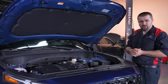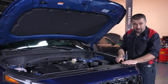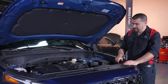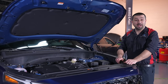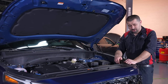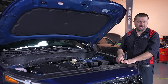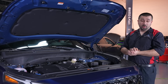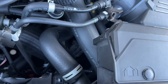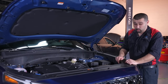Here's an old school-new school mix in a bad way. Older cars used air-to-air intercoolers, but air-to-liquid intercoolers are much more compact and efficient. And vacuum-controlled wastegates work better than electronic wastegates, which suffer from exhaust heat issues. Unfortunately, Hyundai went the wrong way on both counts: they used an air-to-air intercooler, which is inefficient and adds more piping, and they used an electronic wastegate. I wish they had flipped that — an air-to-liquid intercooler and a vacuum-operated wastegate.